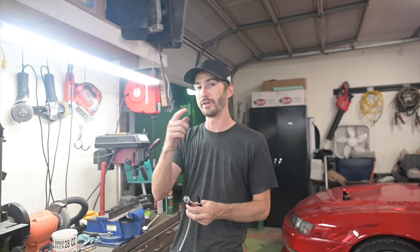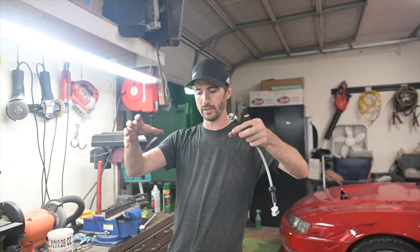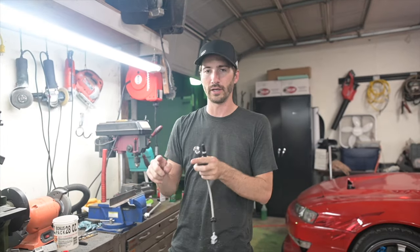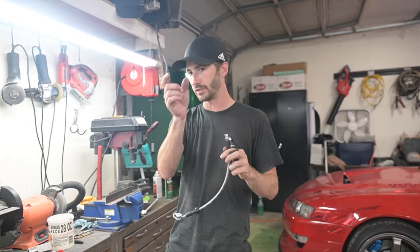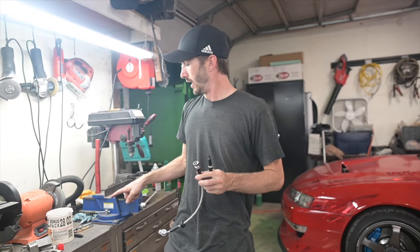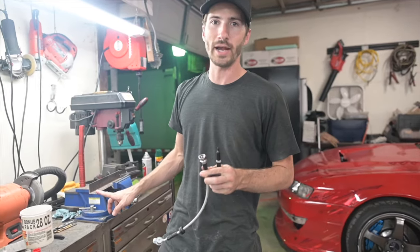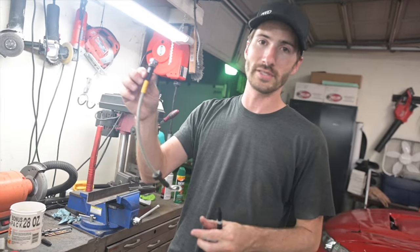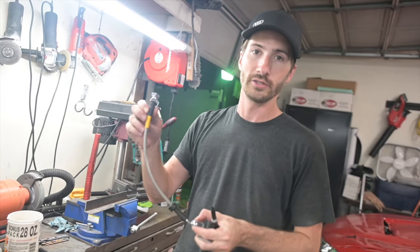And so the way I have it set up right now, because the knuckle has the calipers on the opposite ends, it's got a brake line under the front and a brake line to the rear. So I'm going to eliminate that and I'm going to have two brake lines mirroring the factory routing, and they're both going to be just exactly next to each other. So what I'm doing is I'm building a mock bracket that's just like the OEM one that I'm going to put right next to it, and that's going to be where I put the secondary brake line to hold it.